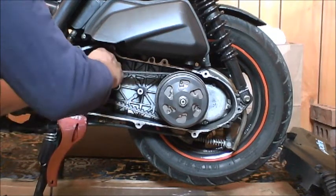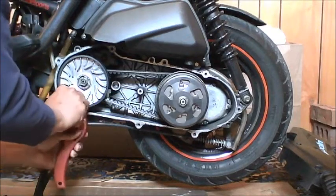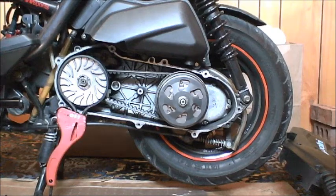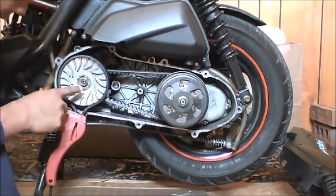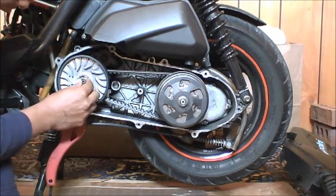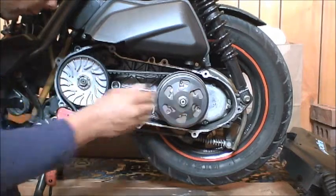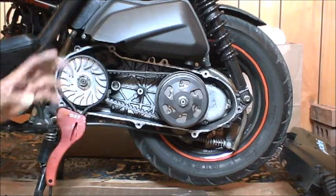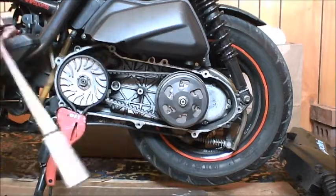Got to make sure that this belt is centered right on the fan, otherwise it slides off either way. For me it's 19mm just so I can use both. I found a nut that has the same thread pitch as the end of the spline here. To me it makes better sense to have one socket for both. You can find that at Lowe's or any hardware place. I like to use a breaker bar — it gives me greater leverage.